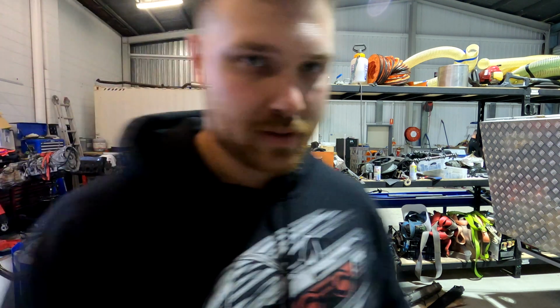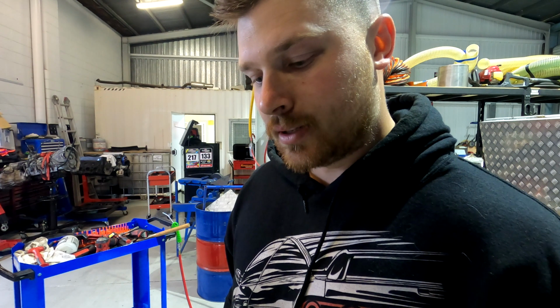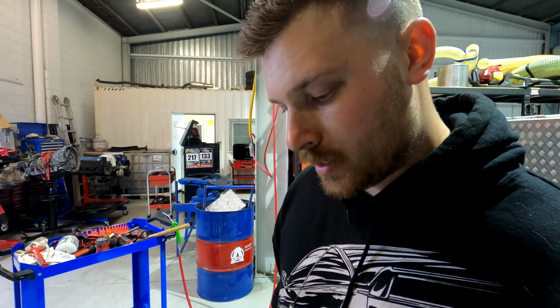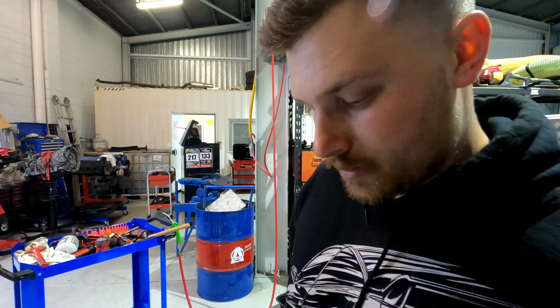So pretty much looking like these pistons and conrods are going to have to go in the bin. Definitely this 6th cylinder one anyway. Not too sure what I'm going to do there, because I do have 5 conrods and pistons that are good from my other block, which has the hole in it, because it was only the 6th cylinder conrod that went. So there is that possibility, but now that I say that, I'm not quite certain that you can use a different cylinder piston and conrod. They have to be in order, so I'm not sure if I can do that or not.